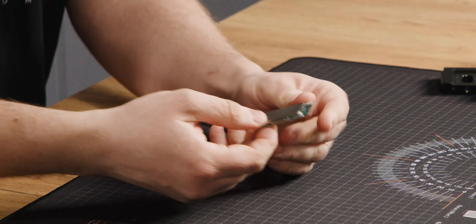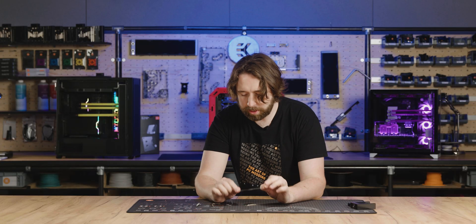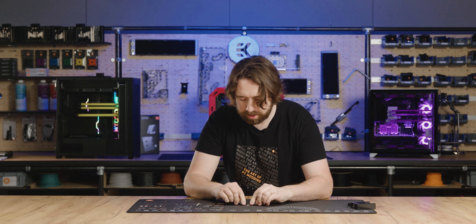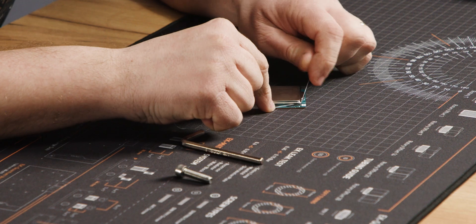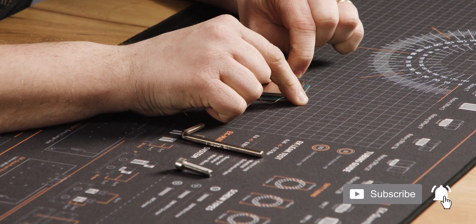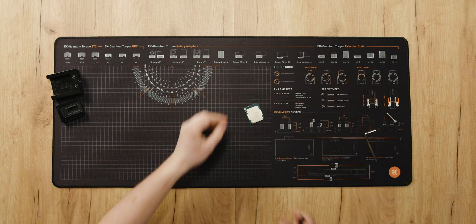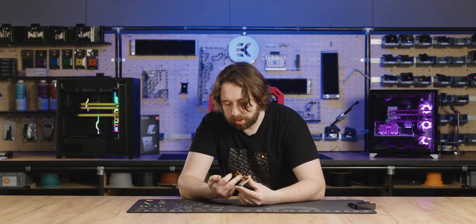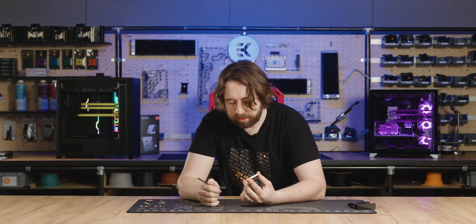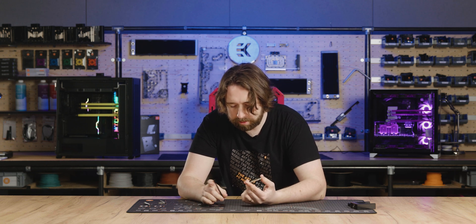I haven't been lucky enough to have one just fall off yet, so I'm going to use this floss to cut some of the glue away around the outside and make sure it's just the indium holding it back. Once I get it under one corner it should be straightforward. Now all of the glue is definitely being cut — the indium has been sheared five times in this case and it's still perhaps a tiny bit warm from the oven.